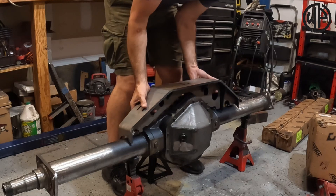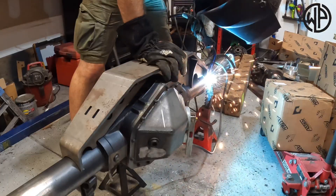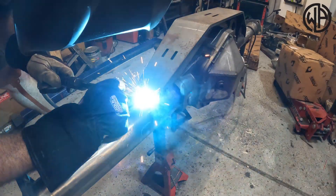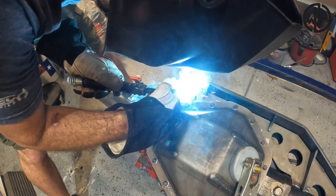As if there was any doubt, Artec uses 3D models directly from the axle manufacturer and a laser design process to make and cut their trusses — it just fits, which is awesome. The first step in installing this truss, especially when you're doing it with a bridge, is to get the top welded in position. That bridge has a little bit of flexibility as far as how it's going to line up so you can get your angle set correctly. So I'm going to adjust my pinion angle a little bit for what's going to work on this rig, then tack all four corners of the truss to hold it in place. Now we start burning it in — always skip around the axle tube so you don't put too much heat into one place and warp it. While the axle tubes are cooling I'm going to weld the parts of the truss where it keys and fits together up top to spread out that heat.